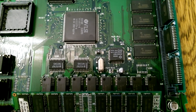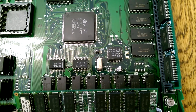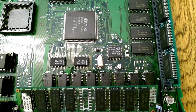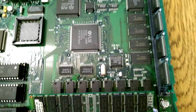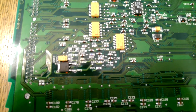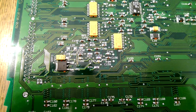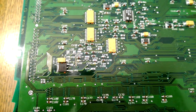Here's how you actually do this. You take R14 and remove it — it's a zero-ohm SMD resistor. You will need SMD soldering equipment and SMD soldering skills. This is not the place to learn; you don't want to ruin your nice old Mac. So you take R14, remove it, clean the solder pad off, and place it onto position R74. Clean up your work and make sure there are no stray solder balls or anything like that, as they'll short out your Mac.